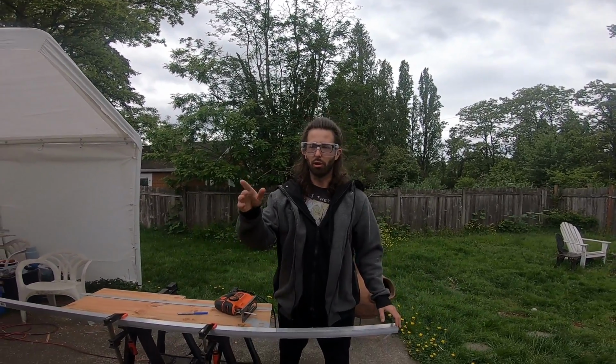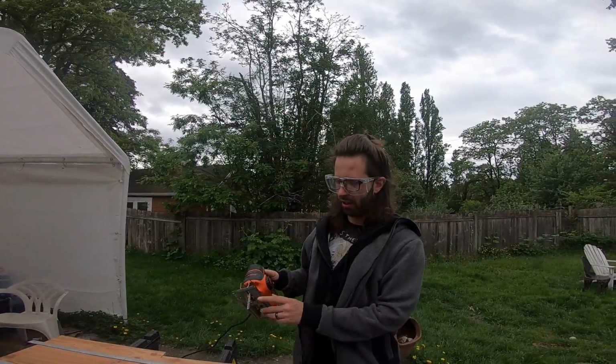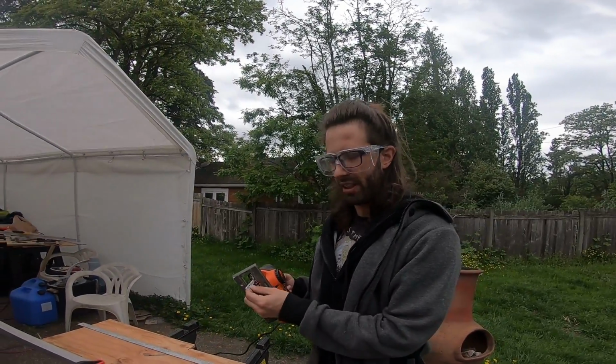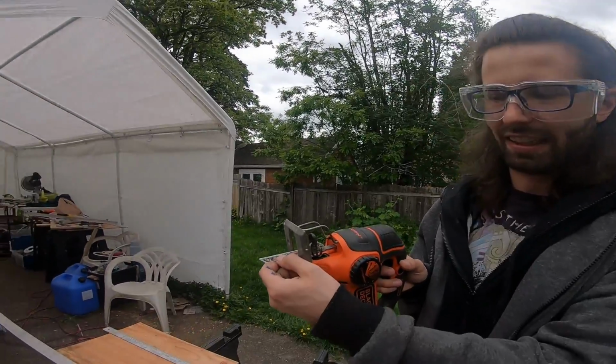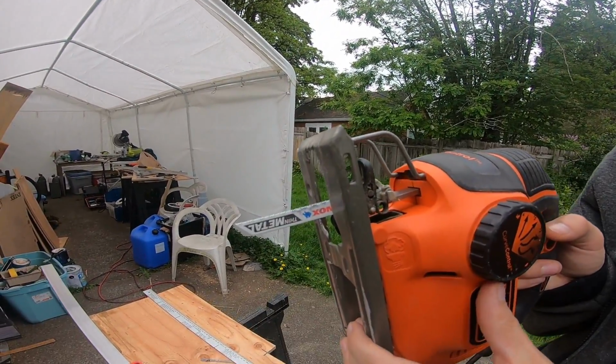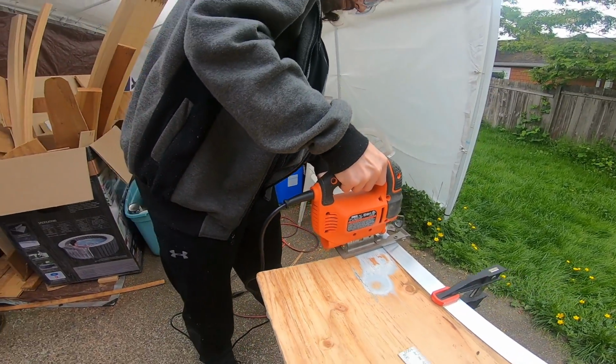So we're going to use this aluminum trim here to finish the wheel well box. We think it'll look nice because it's kind of rugged back there anyway, and we want it to be. I'm just using a thin metal jigsaw blade. I forget exactly how many TPI, teeth per inch, this one is, but you want to get one that's rated for metal. You can see it's got a lot of tiny little teeth instead of the larger teeth you see with wood bits.